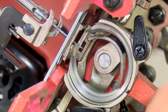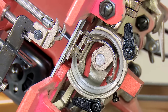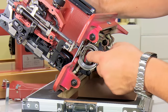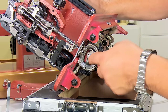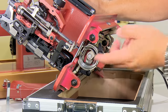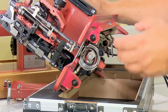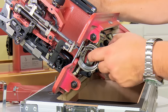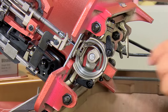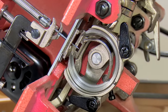The other thing I didn't mention is that not only can this driver rotate clockwise and counterclockwise, but it can also move in and out on the shaft. So you really want to look before you start making this adjustment at how far that center shaft is either recessed in the driver or protruding from the driver. It shouldn't be protruding at all — it should be roughly flush. When you're done with this adjustment, you need to make sure that it stays in that same left and right position.